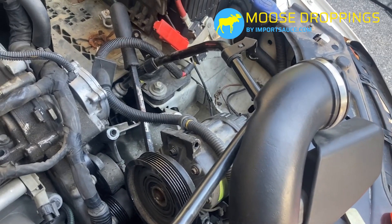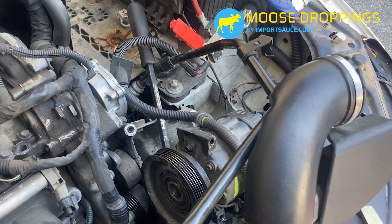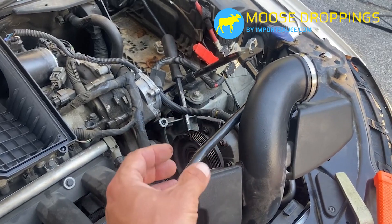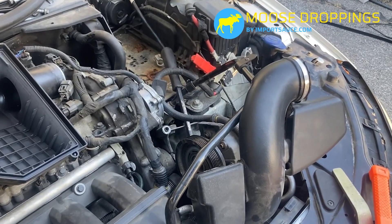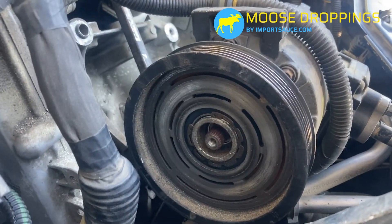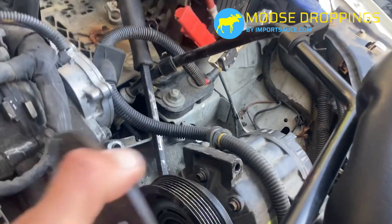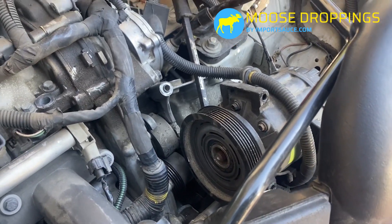If you have intermittent AC — it's working great when the car's warm, not when it's cold, or the symptoms can vary. On the XC60 right now, it happens where as long as we're moving it works, but if we come to a red light, for whatever reason, less tension on the drive belt because the pulley's only running at idle, the AC will stop. As soon as we get on the gas and get our RPMs up, it kind of re-engages. Over time, just like a brake caliper, this plate in there will start to wear out — it's grabbing, it's letting go, just like a brake rotor or clutch disc on a manual. As that wears out, the gap between this plate and that will get wider and wider.